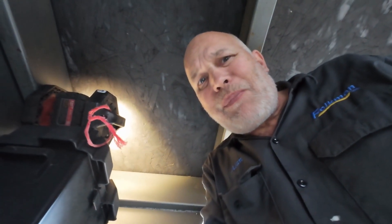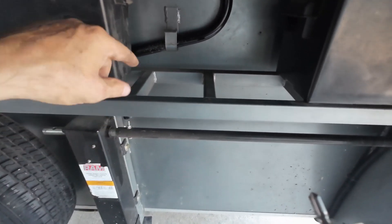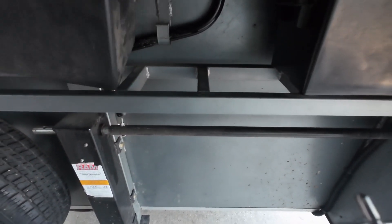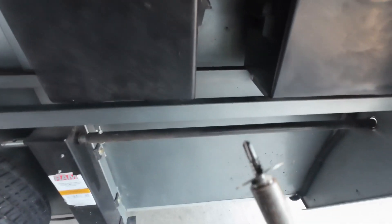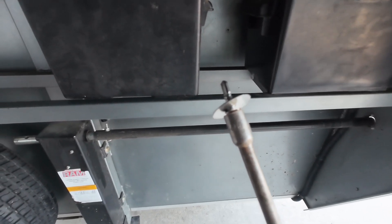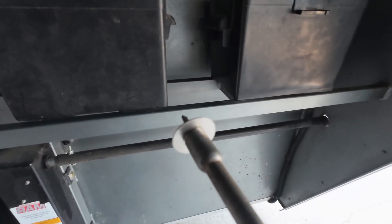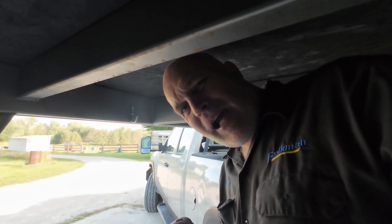One ground stuck in place. Time to put the battery box in. Looks like they've got provisions on here to mount a battery box onto these tubes — pretty straightforward. There are some recesses in there, so I'm good to put a self-tapper in there. This is just temporary to hold this. I'll get her lined up, run a couple of stainless steel self-tappers with some stainless steel fender washers, and we're ready to put a battery in there.